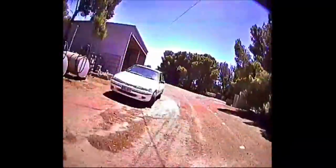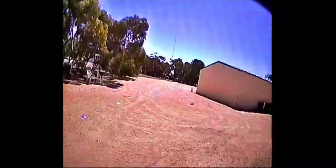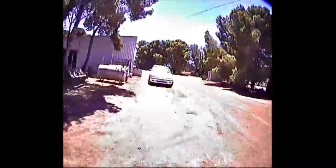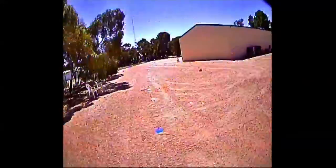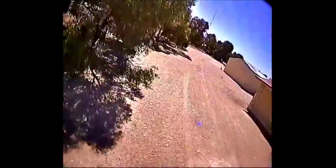Looking at the DVR footage from the figure-8 farmyard racetrack we set up to test these 4-inch quads — the Mitsuko only recording on DVR — it unfortunately picked up a lot of glitches, which I didn't see in my goggles, though when my battery went flat in the goggles I did only see black during that particular crash. There were hash lines and possibly foreign interference or poor antenna position, but ultimately I was able to knock out sub-16-second laps quite easily with this quad, compared to 17.5–18 seconds for the QAV 180 — a 1.5 to 2 second advantage — but at the cost of not being able to carry an HD camera, which might be a downside for some people.